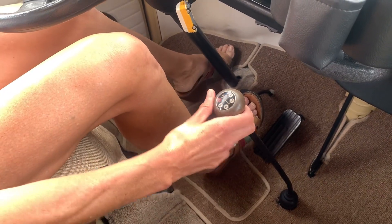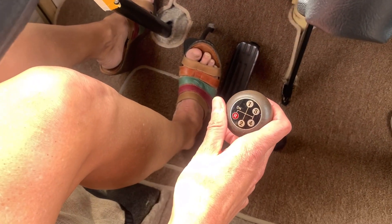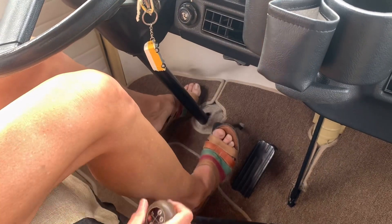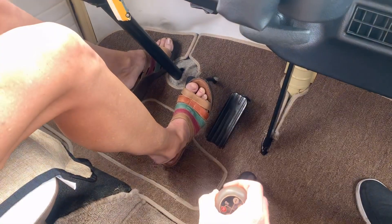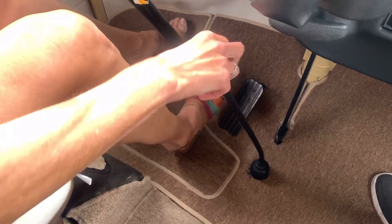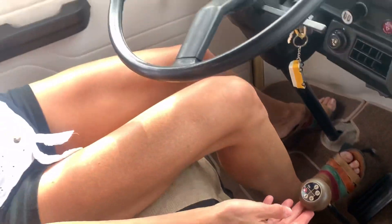This bus is a manual, so let's talk about the shifter. As I said earlier about the clutch, you have to use a little muscle — you want to make sure it's all the way down at the floor. The shifter is a long throw, so you really need to bring it all the way to the top and the bottom for those gears. You'll probably knock somebody in the knee getting into third or fourth, but that's okay. For reverse, you want to push down and to the left. When you hear that little pop, you know it's in reverse. If you don't hear that pop, just try it again.